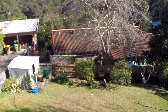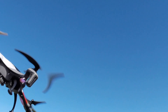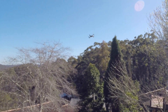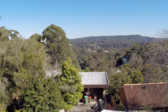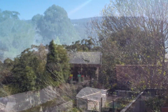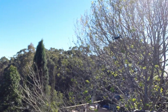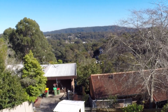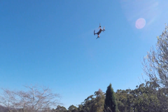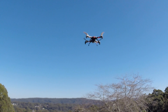This is pack 3 through the new set of motors. It needed the first two packs to actually settle in — it was a bit touchy to fly the first two battery packs, but now the brushes seem to have settled in and it has a quite useful throttle curve. It's not exactly powerful, it's still just too heavy for these motors, but it's flyable.